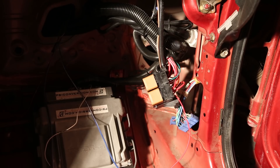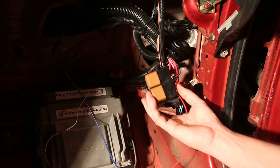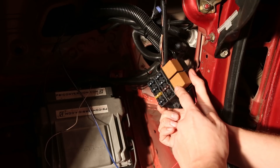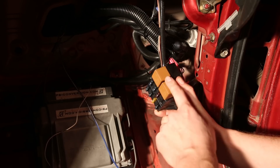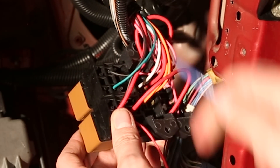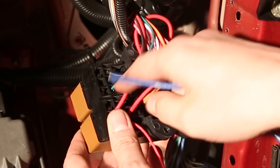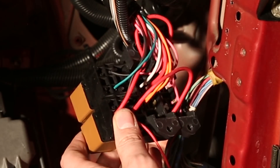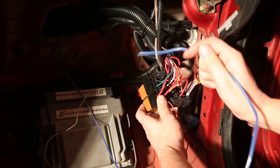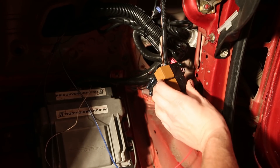A really great thing about going with a pre-made wiring harness for the engine is that you get this kind of pre-made power distribution block or fuse block, and it has a relay for the ignition and a relay for the fuel pump already built into it. So all I need to do according to the instructions is run my 10 gauge line into this port on the relay, and then for this one it comes out to the switch panel I've already set up. It's as simple as just wiring this in and one over there to the switch, and my fuel pump should be ready to go.